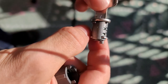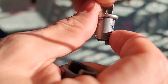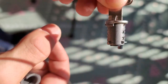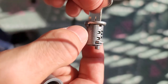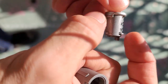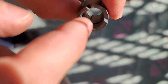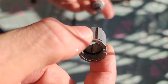However, there is also a fifth wafer here. This fifth wafer — and I believe they're called wafers, maybe tangs — this is what actually keeps this lock in place and prevents it from sliding out of the cylinder. In order to press this one down, ordinarily you would use a control key. A control key doesn't mean it's a master key that can unlock any lock. All it does is, once the lock is in an unlocked position, press in this fifth and final wafer, releasing it from its housing. You can see there's a notch in the back — that's where the fifth wafer sits, and that fifth wafer is what allows you to pull the lock out of the cylinder.